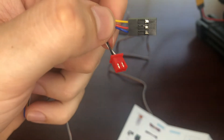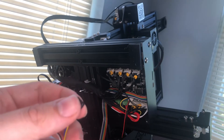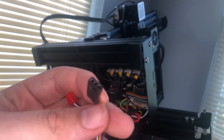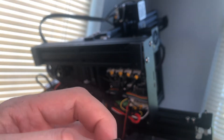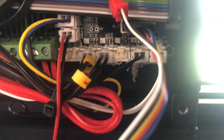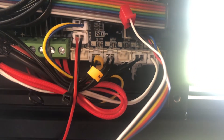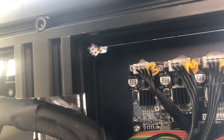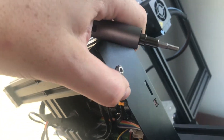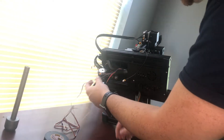Now we have ground, voltage, signal — just like on the Creality board. When you plug this connector in it's going to be pretty loose, so there's a few things you can do. I just took a piece of electrical tape and wrapped it around to thicken up the connector a little bit, but you could also just put a dab of hot glue on there. The reason I went with electrical tape is because I'm going to be swapping out the main board on this printer soon, so I don't want to glue the BL-Touch sensor in. Just a warning: Creality likes to hot glue all of their connectors in, so that was a pain — just be careful, pry out all the glue and then pull the connector out. All right, so we've got our three-pin in the BL-Touch port, we've got our new Z-axis plug in there. You can take the old Z wire and thread it out the top — the connector plug doesn't easily go through, so you can loosen these two screws to loosen the whole casing and pull it out to get a little more hole in there.